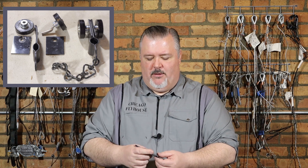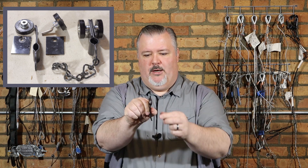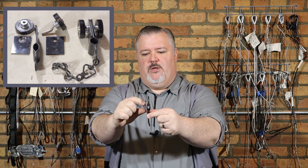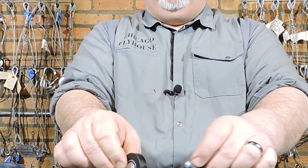Then we get on to the metal ones. The metal ones were interesting because of the visual results we got — they were much stronger. Both of our metal carriers broke at about 1,900 pounds. But as you saw from the video, it was a lot more fun to watch what happens to the metal carrier when we pull on it. We can see we stretched and elongated it, then after some serious deformations, snapped the shaft that holds the wheels and dropped the plastic right off of it.